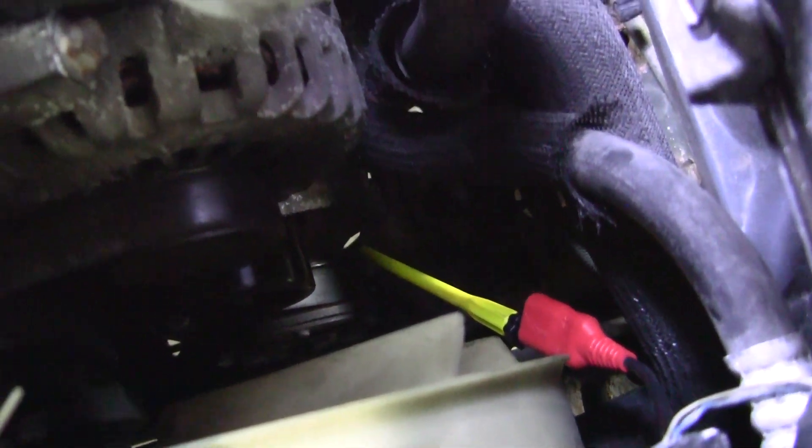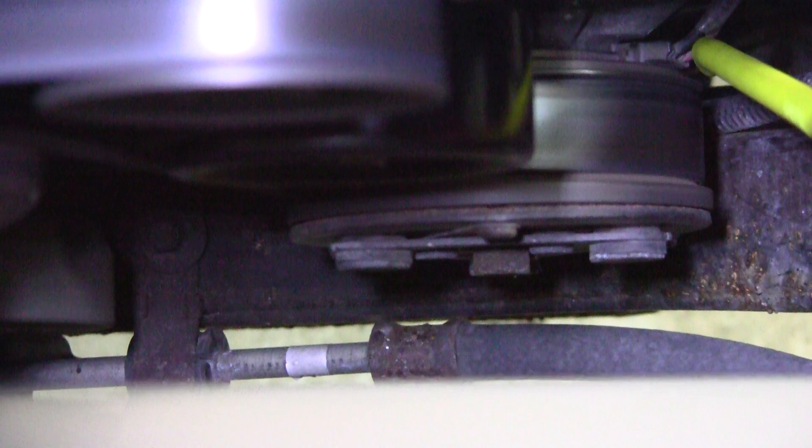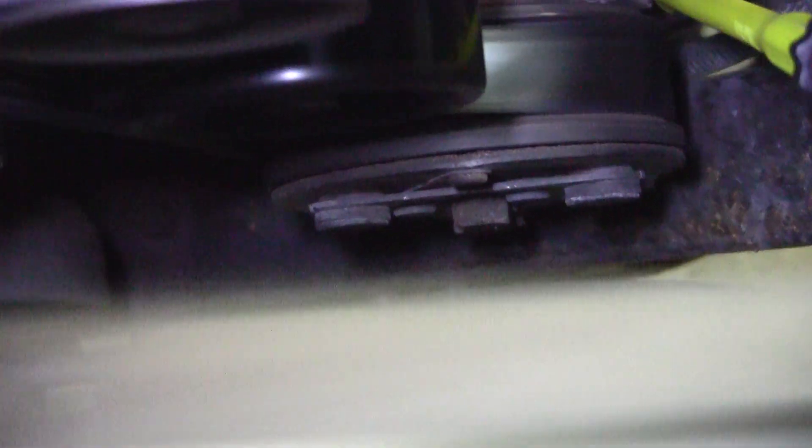I would think I'd hear something. When I feed 12 volts to that wire, there's just the slightest bit of movement on the clutch — like it's pulling in, but it will not engage. Right down there you can see the gap. It's obvious if you know what you're looking for — somehow it's just not wanting to engage. Too bad.